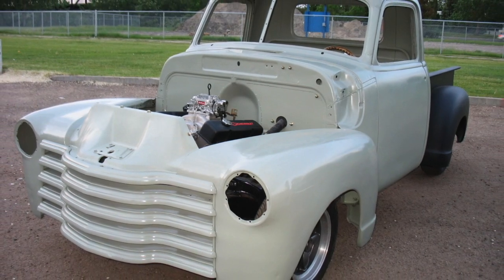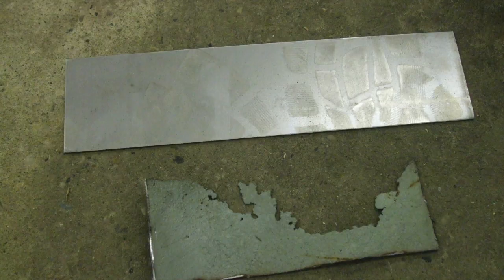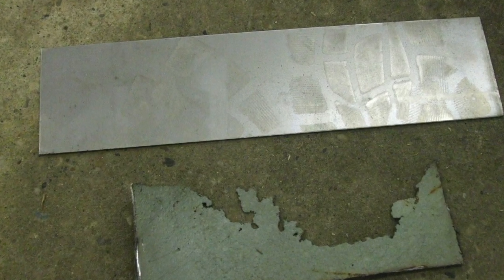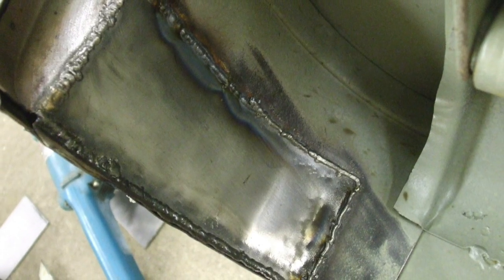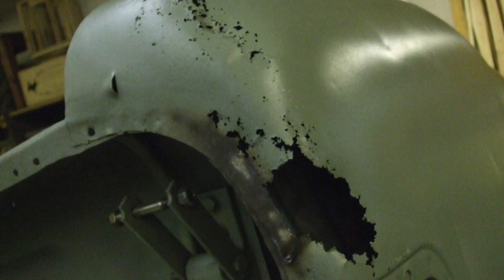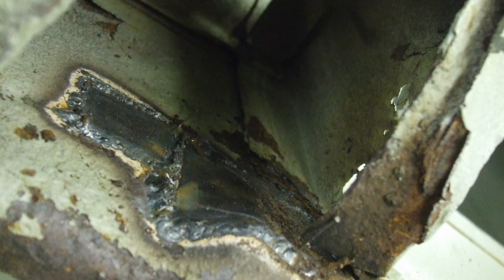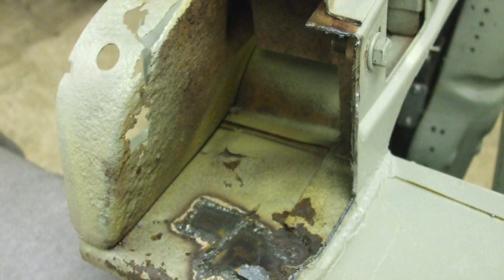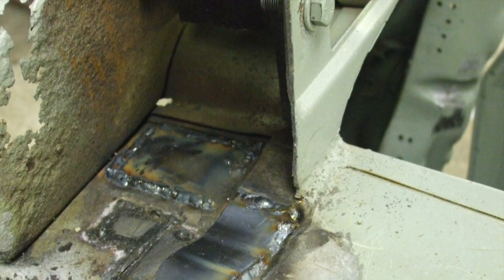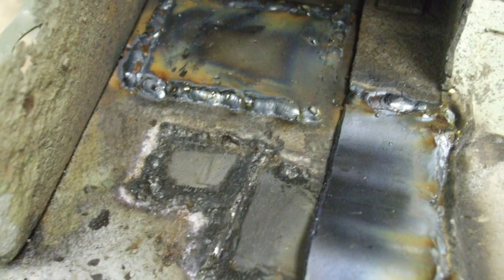I can't remember the camshaft I put in. It was a little bit kind of hefty for what it was, probably the biggest I could go without having to do head work. The body work, I spent about 100 hours just on the cab. Within one week, I spent every day, and we got it. Put a lot of time into it, doing rust repair, and I had the cab blasted and then epoxy sealed, and the frame I had sandblasted, and I used POR-15 paint to finish that.